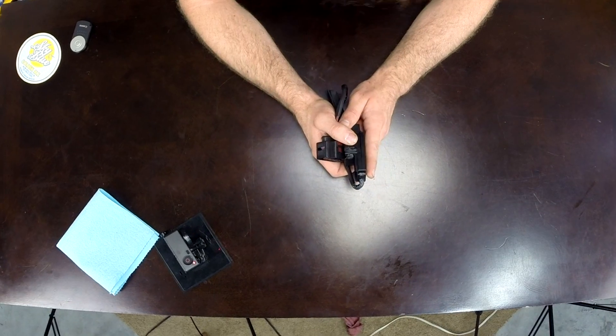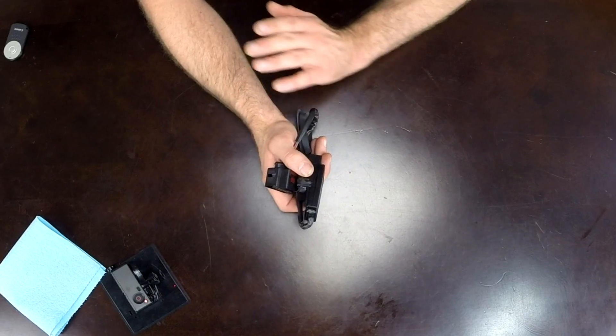This is what actually does the turning on and turning off of the in-tank fuel pump. The in-tank fuel pump is a pulse width modulated pump, which means that it's turned on and off really fast instead of being constantly on. And because this is a control module, there's probably a lot that goes on inside of this little box that we really don't know — but we can tell when they're failing.